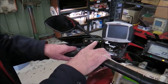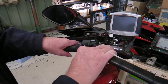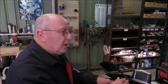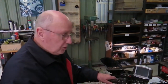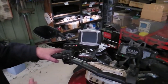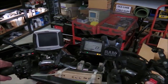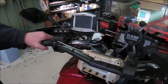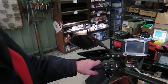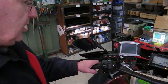If we now press the on/off button again for two seconds the LED will go red and we're in another mode where we can test how much free play it's got before it starts to apply throttle using the throttle-by-wire. Now to do this test we need to start the motor — make sure you're in neutral, pull the clutch in, start the engine. The set key in this mode will advance the throttle incrementally for each press and release, a tiny amount.